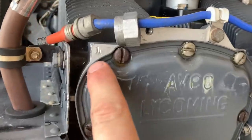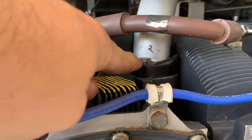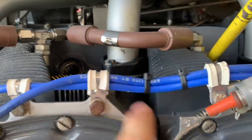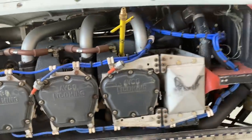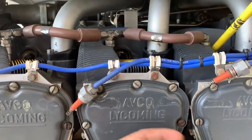This is confusing — there's a number one stamped on the cylinder and a number six stamped on the cylinder. Somebody wrote number two on the intake tube, this one's got a three, intake tube's got a four, this one's got a five, intake tube has a six. My guess is it's one, three, five — like normal. It's just the pushrod tubes on the bottom, so somebody thought it was like a Continental.